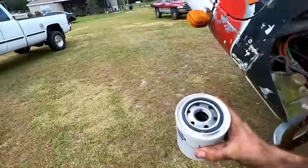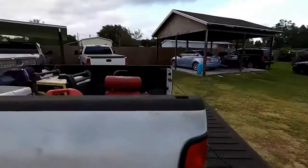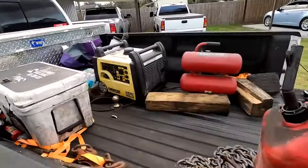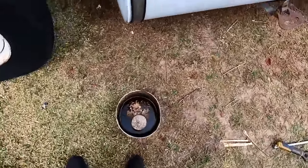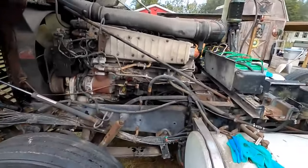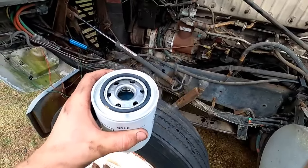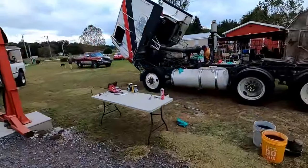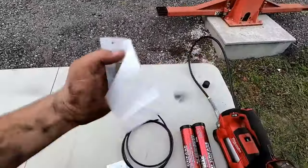I'm going to go ahead and pre-fill this fuel filter too. I have some fresh diesel in the truck here, just so I don't have to worry about bleeding and having to pump all that diesel up into the engine. The diesel in this old filter looks nastier because this is low sulfur diesel — back in the day it was high sulfur, which was a little thicker and actually had more lubrication for these engines. Now we have to deal with low sulfur diesel. Chris got the engine completely full of oil, the fuel filter is changed, and now I'm grabbing a pair of cutter pliers to repair the airline for the rear end power divider splitter.